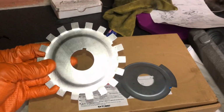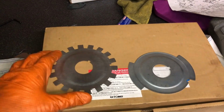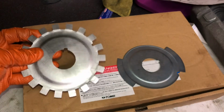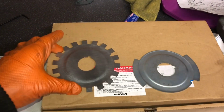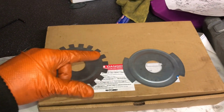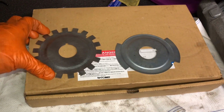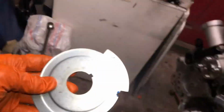This crankshaft triggering is off of a Group A Evo 6 rally car. Obviously they could run a much better system and they wanted a much more precise crankshaft position. So what we're going to do is set this one up. It's not going to be straight away. We want to get the car running first. We're going to set it up on this, then we switch over to this. It's got to be timed right. You've got to take off one of the teeth to make sure that the ECU has a point of reference, one missing, to see where the crankshaft position is. And then there's a lot of settings to be changed inside the ECU. So that's another upgrade for the future. Obviously going to just start up with this one to make sure everything's good.